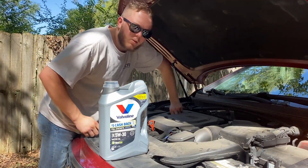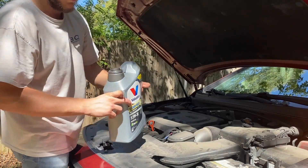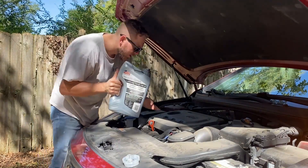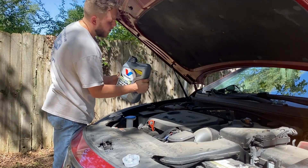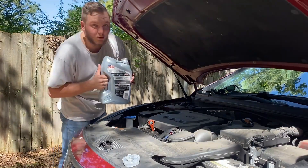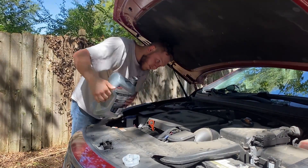This part's super duper simple. Take your oil filler cap and pop it off — just twist off, it's a little plastic piece. Valvoline is nice enough to have special pour spouts now, so it's super easy to pour. If you have the older style round bottle, you pour it over the top so air can come in — kind of like filling a radiator — no air vacuum cavitation. Pour it over the backside, air comes in the top, pushes the oil out. This car takes about 4.7 quarts, so we're going to give it 5. Five quarts in.